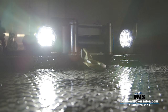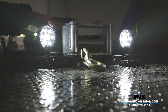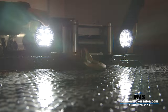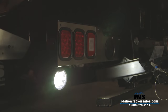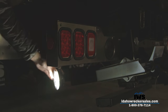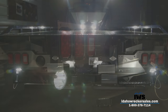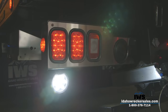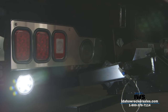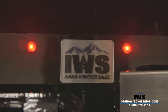We've installed LED deck lights that can be repositioned to whatever angle you need — a tremendous benefit to the tow truck operator who needs to focus light underneath the car or off to the side to augment the alley light from the side puller. We've duplicated the same lights as lower work lights for the wheel lift, also on a swivel pedestal mount. All the body lights and tail lights are also flashing — this is the popular digital marker strobe kit, installed on a separate switch in the cab, which gives your body lights and tail lights a strobing capability, adding red lights flashing alongside your ambers.